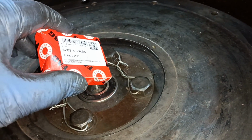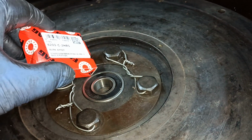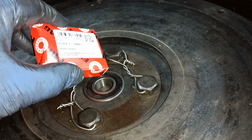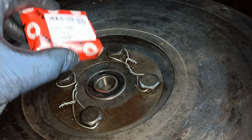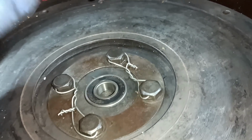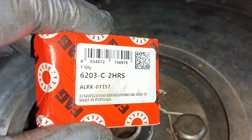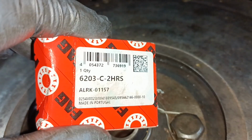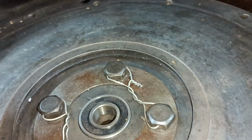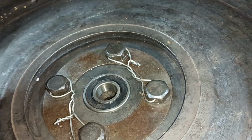And it's 17mm bore and 40mm on the outer diameter, and that was a metric bearing that was used by Ford right back in the 30s, and possibly before as well. Anyway, like I say, just look up those, and you can probably just get them locally from a bearing supplier. I got these relatively locally. You don't have to buy early Ford parts, is what I'm trying to say.